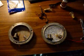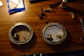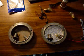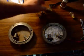I've had one heck of a time with these lamps. I had never heard of 1158 bulbs before — they're like 1157s, dual filament, but they're for 6V. So if you try and hook these up to 12V, they just burn out. And of course I'm going to be running at 12V.